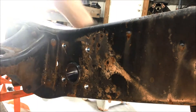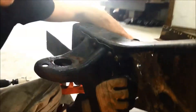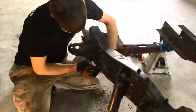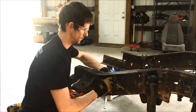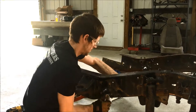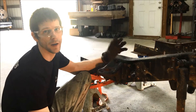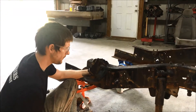If you have to slightly wiggle and rock it to get it in there, that is fine — just make sure you don't have to beat it in. Once all your hardware is on and pulled up nice, torque the 7/16 bolts to 50 foot-pounds. For this illustration I didn't put crimp nuts on the back, however the hardware we supply does include crimp nuts to keep those retained.